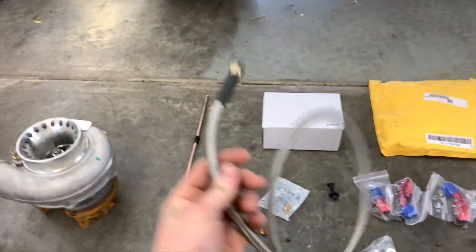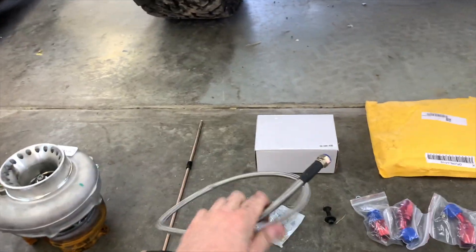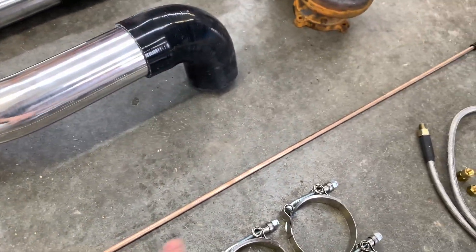The turbo kit came with steel braided lines, but I'm not going to use it because the sizes on the ends of these hoses are really strange. One's metric and one's a pipe thread, and I couldn't find the correct adapters. So what I did was I got a hard line. The turbocharger sticks out of the hood and so will that braided line. I don't want it to move around, maybe hit something or get burnt. So I can bend this hard line however I want and I don't have to worry about it moving around. It's going to take a little bit more work, but it'll be better in the long run.